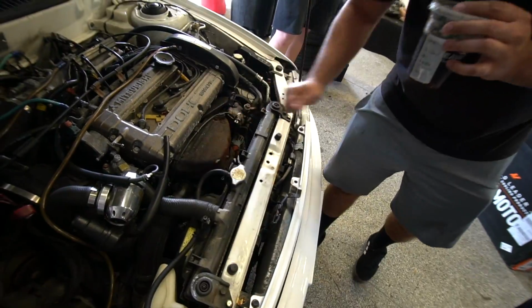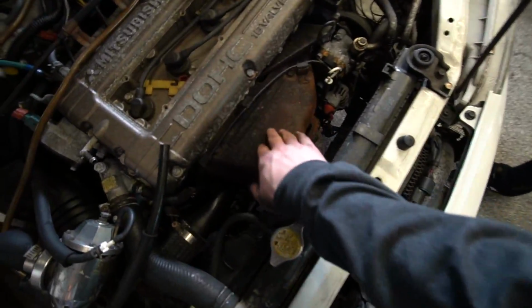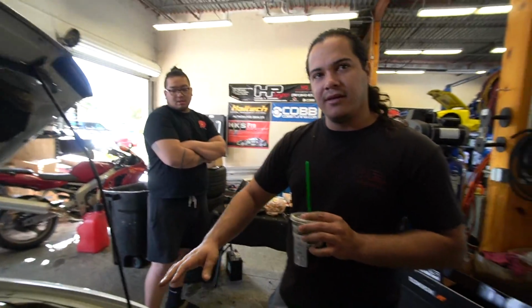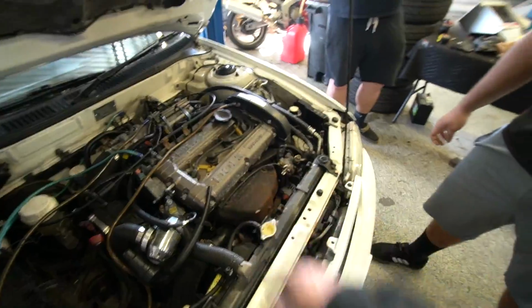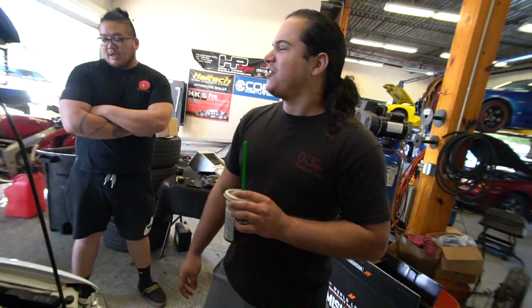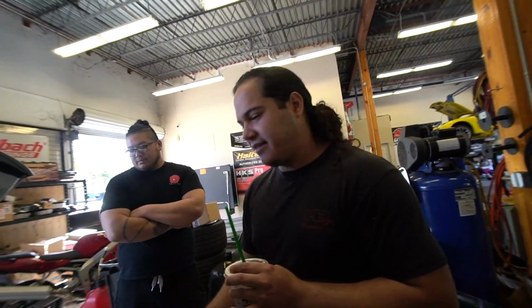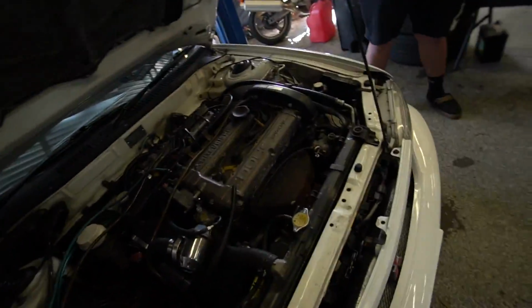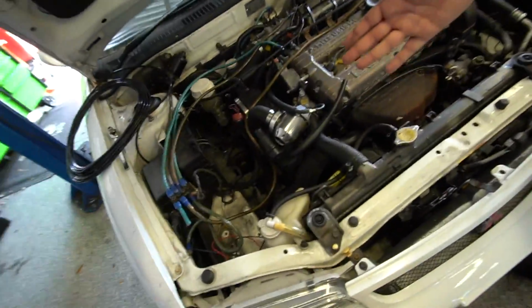He can actually powder coat these. They'll sandblast them and powder coat them. The shields? Do you need the shield? It keeps the temperature of the engine bay down. I think it would be cool to get it the same color as that, or black. Have you ever seen an SRT4 or an SR swap car where everything's turned really brittle and breaky? Those are people that took their heat shields off. Once you take this off, your engine bay temperature is just gonna go through the roof. So technically there'd be more heat soaking. Correct. And with a closed hood, your intake's gonna have more heat. Your cold air intake is gonna be a hot air intake.